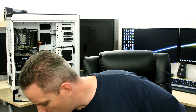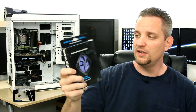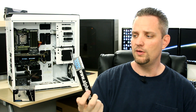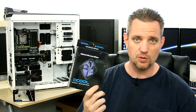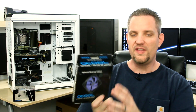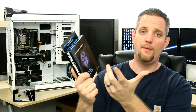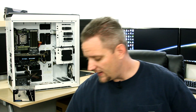Of course you have to have your fans, so they come with three. These are the NB-E loops. You may think these look a lot like the Noise Blockers — and some of you might think they're a rip-off. Well, AlphaCool actually designed this fan in conjunction with Noise Blocker. They did the exact same fan with the same rubber styling we love about Noise Blocker fans, only they're in blue because AlphaCool is blue. They are 1200 RPM fans with great static pressure. That's why they include them in the kit. I highly, highly recommend them.